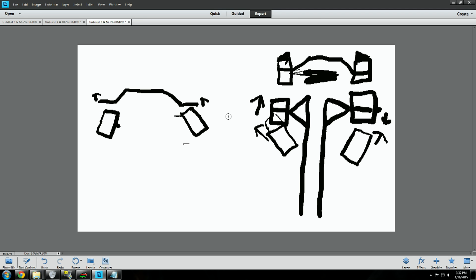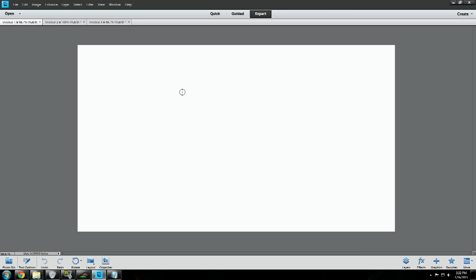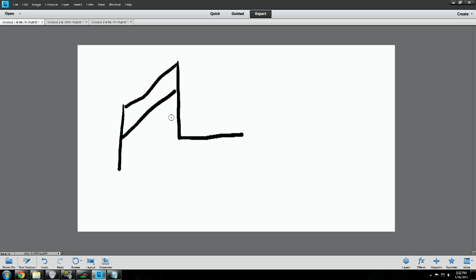And I should also talk to you guys about A-arms really quickly. If you're doing an A-arm setup on one of these cars, you have your tire here, your top A-arm, and your lower A-arm, and this is your frame. What you want to do is make all of these angles the same. You want this angle here to be the same, and if this was to extend up, you want this angle to be the same, and this angle, all the exact same angle.